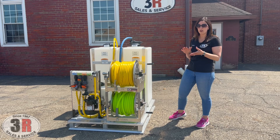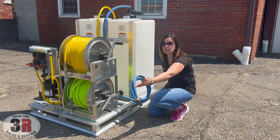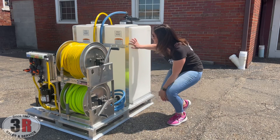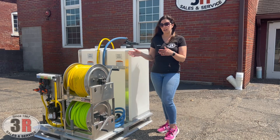We have a three-quarter inch drain for the water tank right back here. We've got a ball valve on the end so that if this is sticking out right outside the end of your van or truck bed, you can control it just by opening and closing the valve. We do have additional valves between the tank and your filter so you can clean out that filter very easily without having to empty your tank completely — just shut off the ball valve, clean out your filter, put everything back together, and you're on your way.